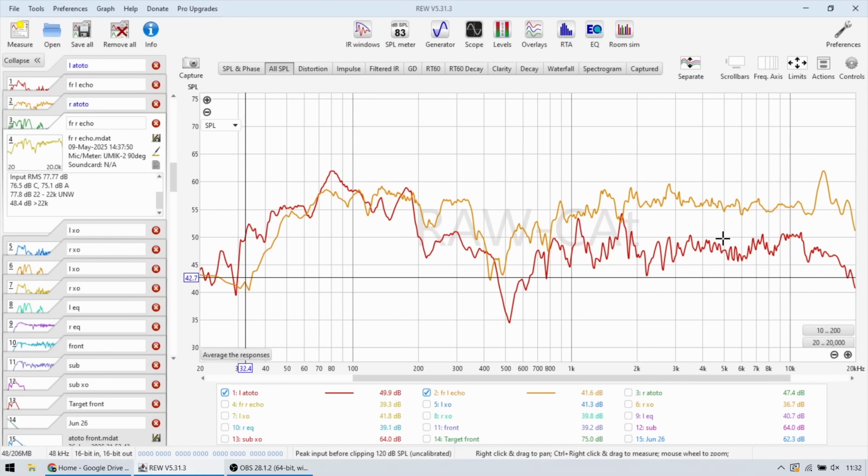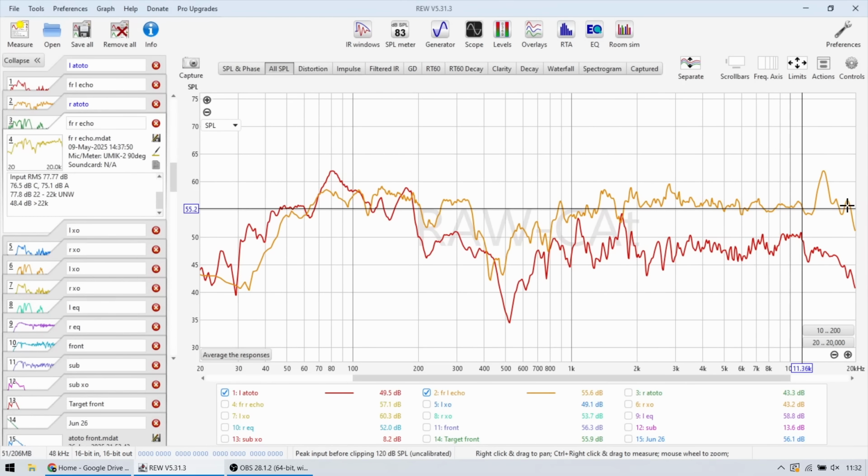However, the higher frequencies are a bit attenuated just because with the components, you do have a tweeter much higher and it's not lost in the kicks being off axis. And especially you can see that in the upper frequency extension where the component in the sail panel can play all the way up to 18, 19K, and this one starts to roll off quite early.